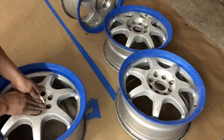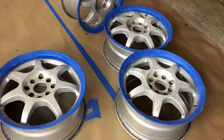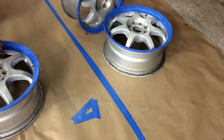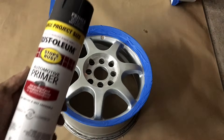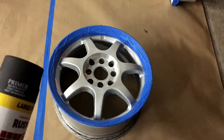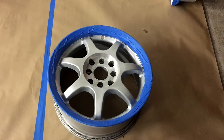I'm using Rust-Oleum's automotive primer. This is really good stuff — this is dark gray. I just chose a dark color since it's going to go black. I'm going to put this on and make sure everything's covered on the inside and outside facing of the wheel. After that's dry, we'll hit it with the Rust-Oleum Advanced Formula.